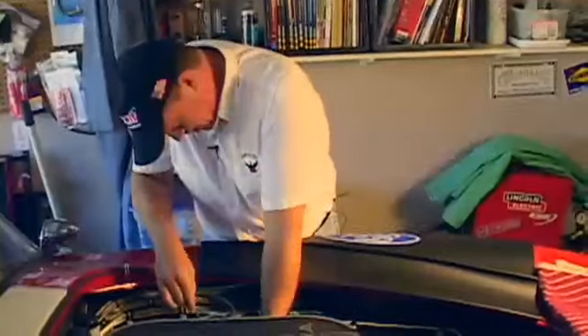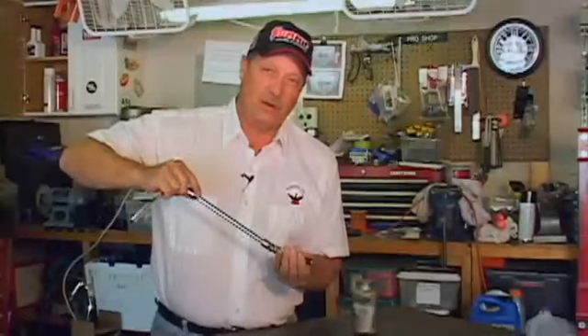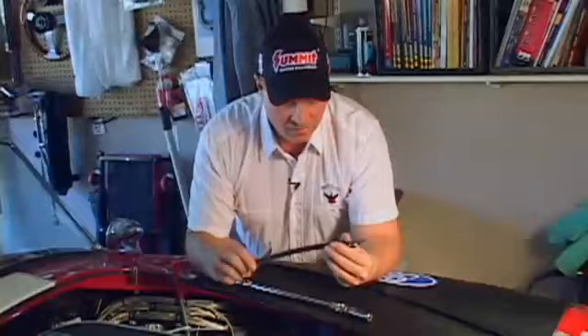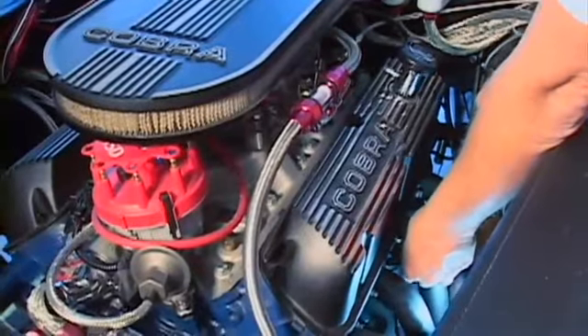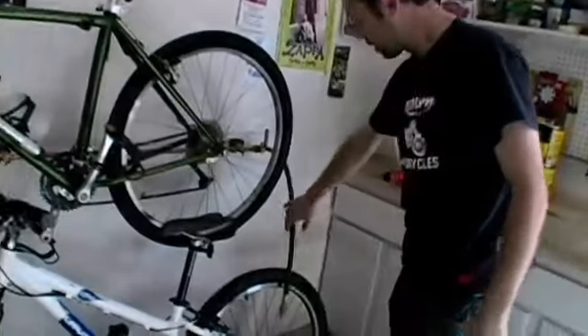you can sit there and spin it and turn it into place by hand. Once it's tight, you pop it off. You haven't damaged your insulator. Now you can easily slide that socket down onto it and then you're only going to turn it maybe an eighth, quarter of a turn at best. It's a lot easier to install the spark plug using my tube method versus using the very stiff socket set and wrench set. I'll see you next time.